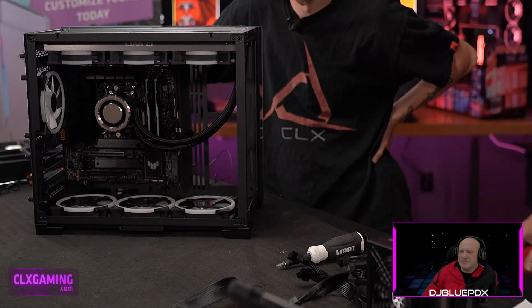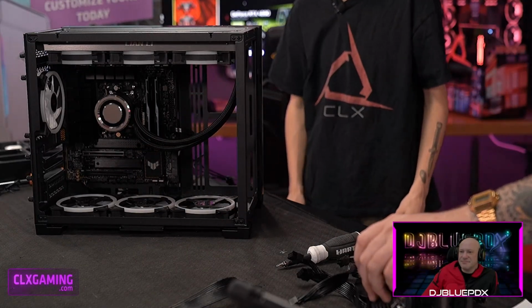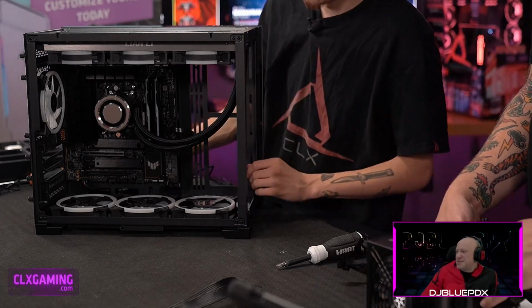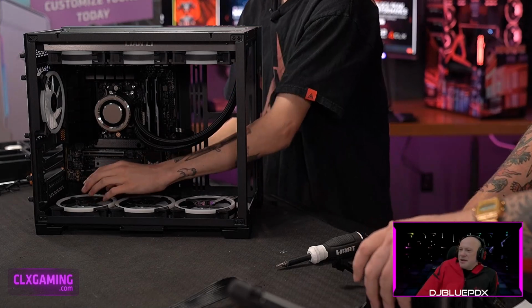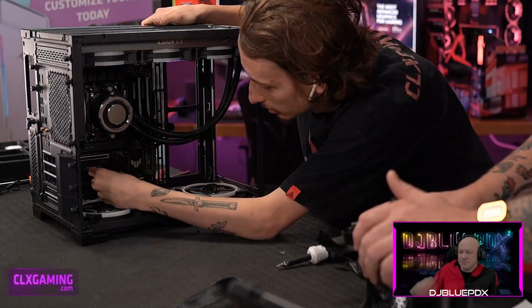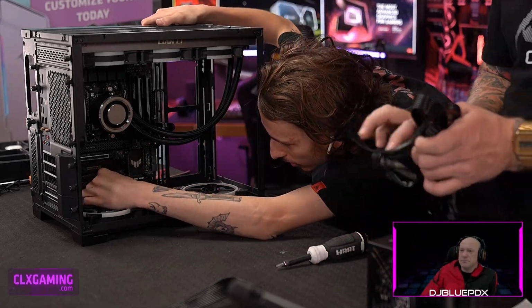When I built my first PC, the GPU wasn't clicked in. Oh, yeah. So I didn't get video. I thought I broke it. Yeah. Gotcha. Typically, if you don't get video and everything's plugged in and has power, the next thing is to reseat your video card or make sure the power connections are plugged in.